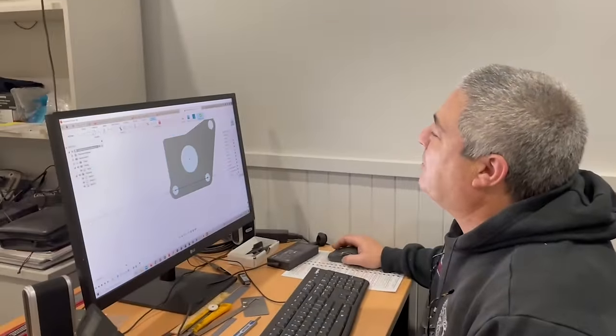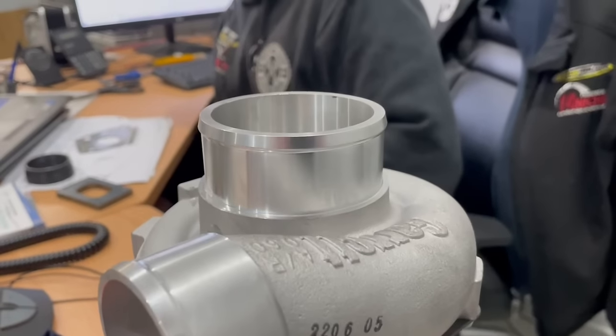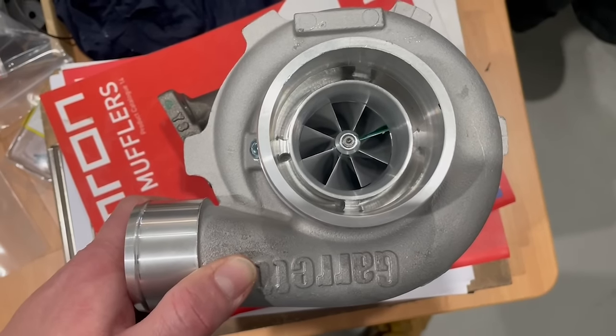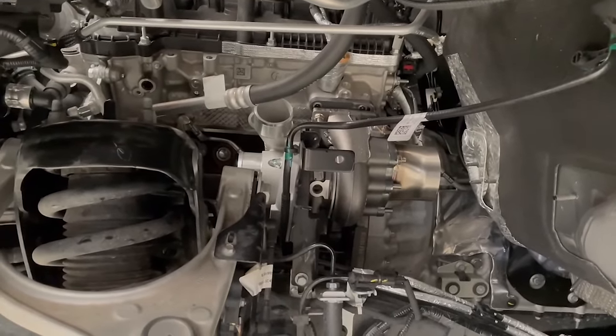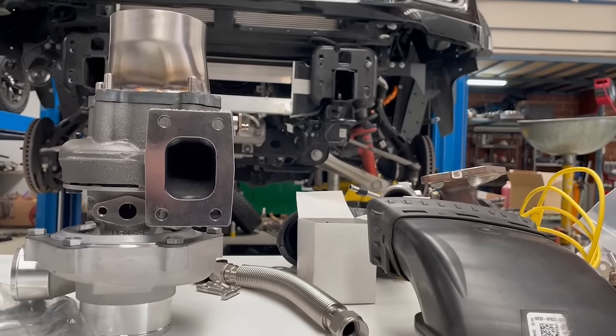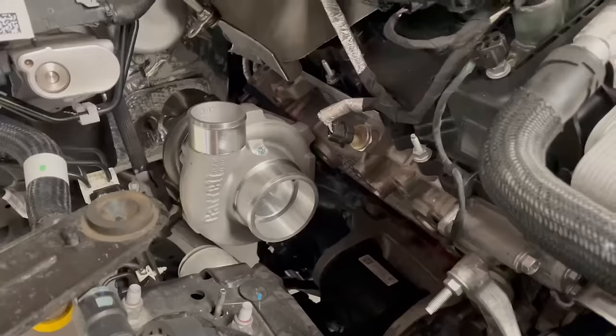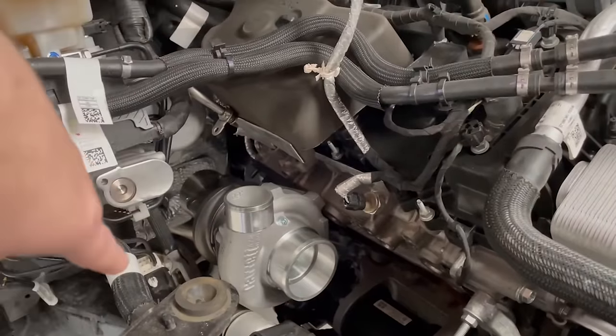I'm drawing that up at the moment so I can get some laser-cut pieces made straight away. It should be a fairly straightforward little adapter — no manifold needed. The new larger turbo is quite a fair bit bigger eyeballing it against the factory unit. I'll throw the camera around in just a second and show you exactly where the new turbos sit. We still need to manufacture the dump pipes — we've just got the flanges tacked in place for a sneak peek at how these new turbos fit on the Raptor. There's the driver's side turbocharger.